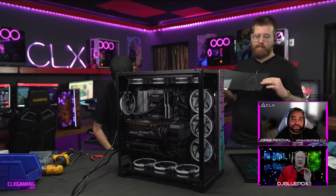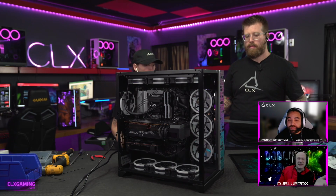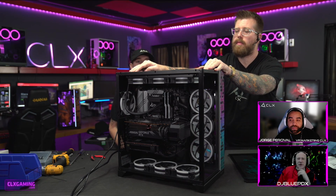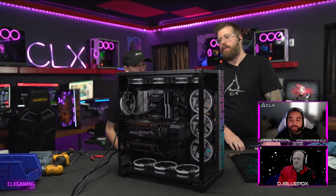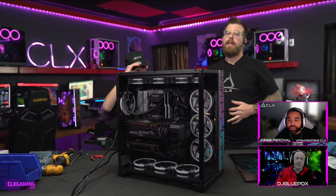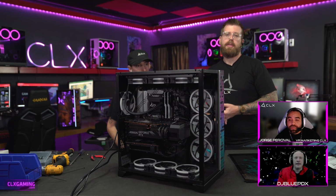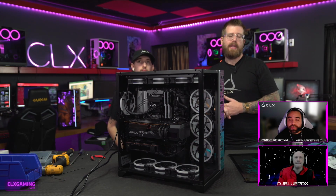So with regards to that, let's talk about one thing I wanted to point out that Paul and Hayden are involved in. What happens with these PCs once somebody puts their PC together, puts it in their cart, and orders it? What goes on once it's built? Yeah, so every machine after it's built goes to our testing and integration department. This is where we'll first get into the BIOS, make sure everything's set correctly, download any software, and install the operating system that the customer has selected. And then we put every system through a 12-hour stress test. If there's a component that is going to fail, usually it's going to fail within that 12-hour stress test, and that allows us to catch it there and replace it or fix it. That way we deliver a solid computer to the customer. Every machine we do goes through that testing.